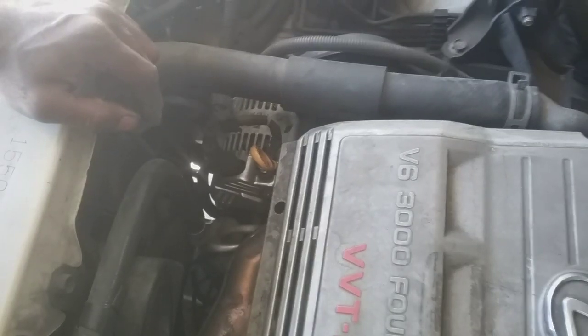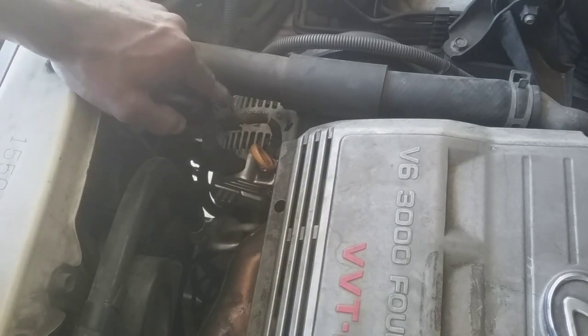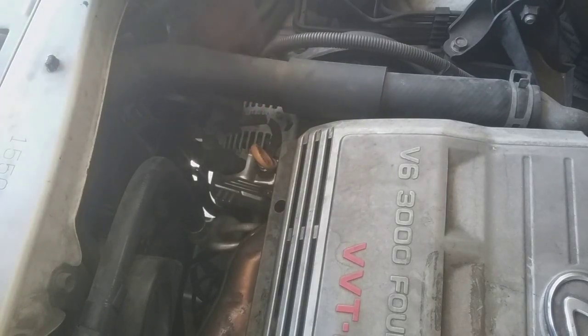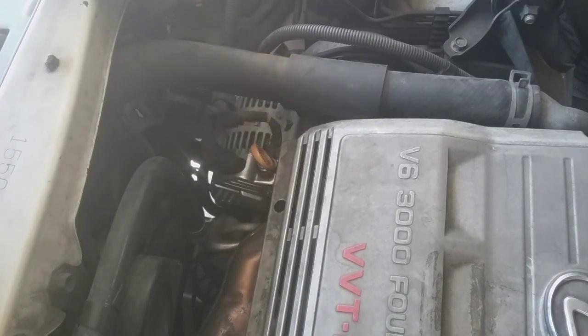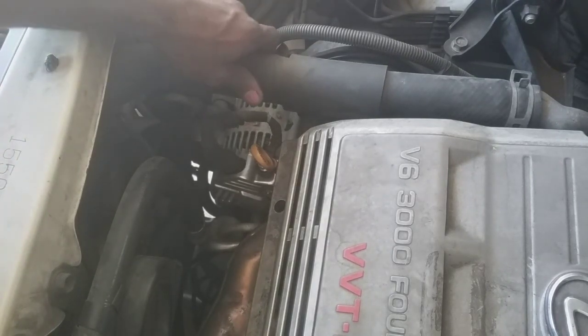I got the 2000 RX300 back. This time it's making a strange noise and it's coming from the alternator, like a frequency type noise. The windings, once you look more into it, are burnt up. You can see there's heat, some type of high resistance heat soaking, or it could be throwing out an overwhelming amount of amperage. I'd assume it's shorting out in some fashion. Something's happening where it's shorting out inside, I'd assume, but I'm not going to go too far in investigating that.